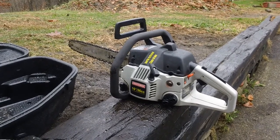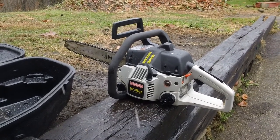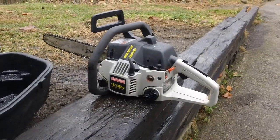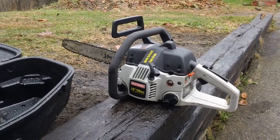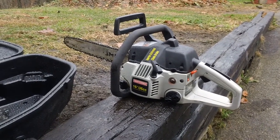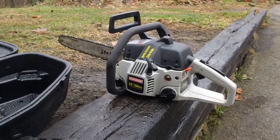We checked it out for him, and the good thing was the cylinder and the bore were perfectly clean, with no scoring, and remarkably it had about 150 psi of compression when we did the test with our gauge. Because of that, plus the fact that the cylinder is completely clean inside, without any scoring, scratching, or scuffing marks, the machine was definitely worth repairing.